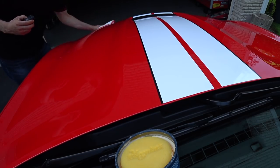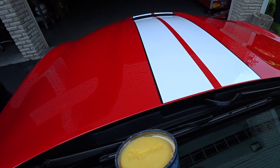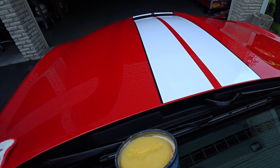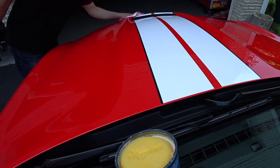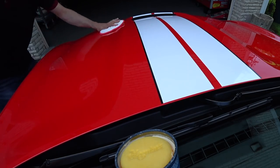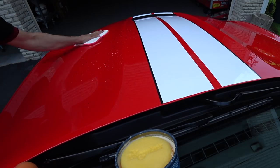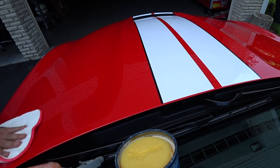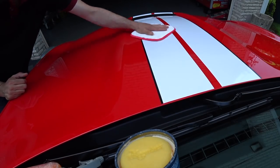The shine looks incredible — this is the best wax you're going to get and it's only about $40. You can pick all this stuff up on Amazon in two days. Please send me photos because I love seeing before and after results. A lot of you guys starting professional detailing are loving it because you're switching products and getting away from cheap stuff with fillers. Give it a little mist of VO7 again — the Collinite 915 has a very high carnauba content and you really have to go over it in the removal phase otherwise you'll see smudges on a sunny day.